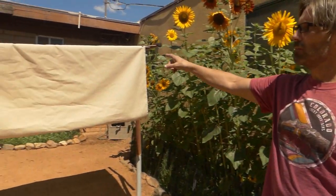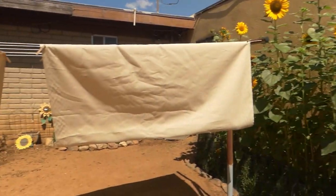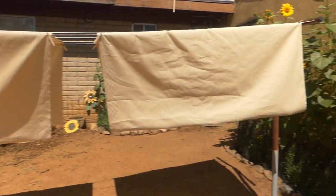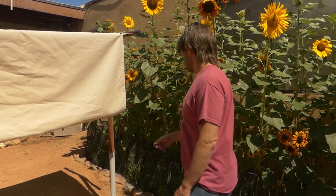I don't want to fully shrink the canvas because I want it to stretch a little bit and get tight. That's how you keep from having problems with air bubbles. You want that canvas to actually shrink a little bit when you're installing it so it pulls tight. So I've hung the two pieces I'm going to put on the bottom up on the clothesline, and we're going to hose them down and let them dry. I'm only going to do this once so it'll still have a little bit of ability to shrink more once I install it.